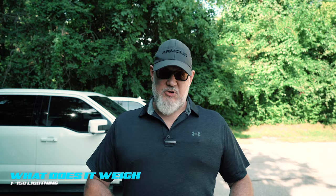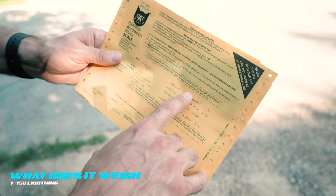When you handle it, it really needs to be on a 26K or better carrier — a 26,000-pound GVWR carrier or better. You don't want to be putting this on those smaller trucks; it's really too much weight. I've scaled a similar platform on a smaller truck and we were about 1,400 pounds over on the rear axle of an F-600. Also keep in mind: we're almost a 50-50 weight split, and what I've discovered is these vehicles that are 50-50 split have almost all that weight go onto the rear axle of those small carriers. It's really hard to roll weight into the front axle.